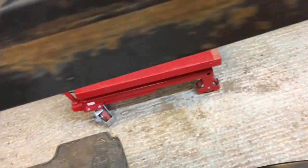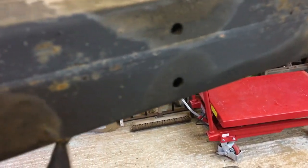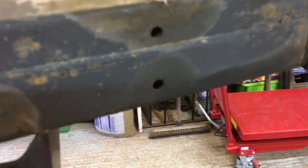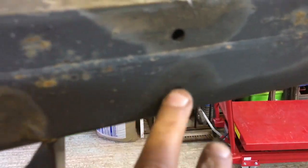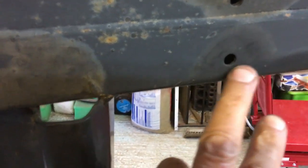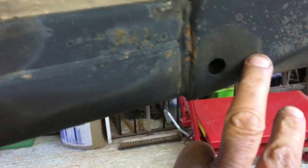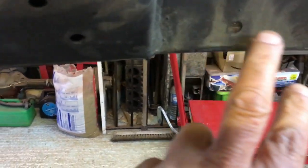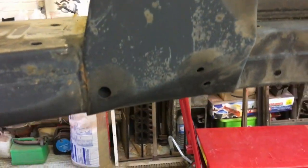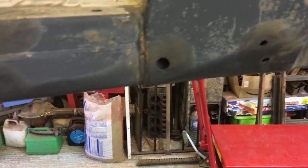But what you'll also see is, in areas where I haven't cleaned, this is the beauty of wax oil. The wax oil has been sprayed on the inside of the chassis and it creeps, it sort of wanders along the surface for years. And this was put on like 9.5 years ago. And you can see how it's crept out of these holes and it creeps around. You see the same here, here, everywhere there's a hole, you can see it's crept out. So I'm just removing this now with white spirit before I go around and do some prep work.